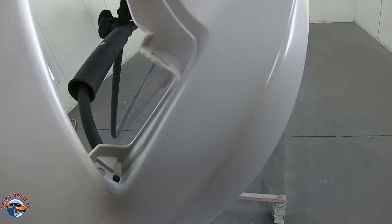All right, fellas, and this is what we're talking about. Check out how fine those droplets are. We know that this is such a soft and smooth pattern, exactly what I want in a primer gun. Okay, so primer all down. We'll let this cure. We're gonna come back and sand this, and let's see what that CC500 can do for sealer, base, pearl, and clear coat.